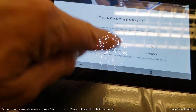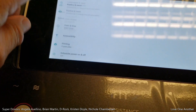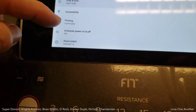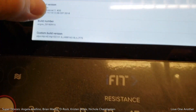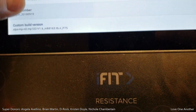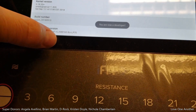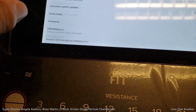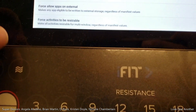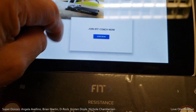I'm going to swipe up, go into admin mode, go into settings. And if you notice, there is no developer options, so we're going to enable developer options. How do you do that? You hit 'About tablet,' come down to the build number, and keep hitting it — you're now a developer. So if you go back, you have developer options. Scroll all the way up to where it says 'Force activities to be resizable,' click on that, then back out. We're going to reboot this and try it again.